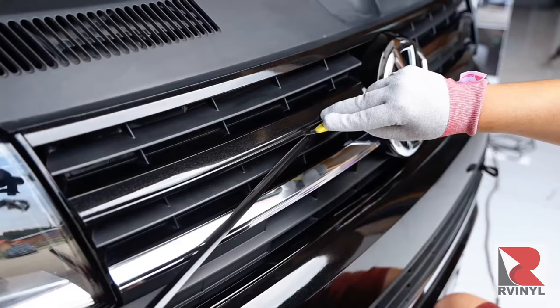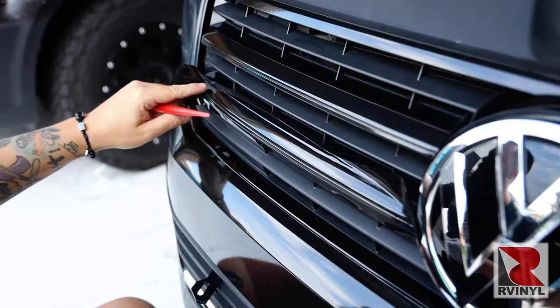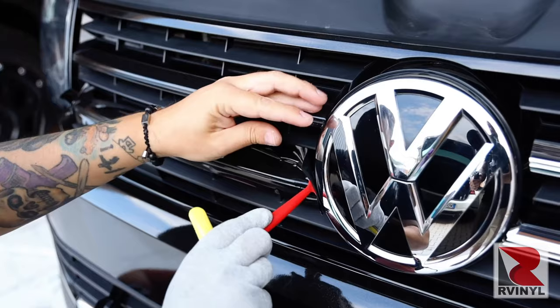Keep in mind slight modifications might have to be made to the workflow. Here the material is being formed to the main surface, but the vertical pillars are keeping the material from touching the main surface, so relief cuts are being made. This relaxes the film safely so the material can now be taken all the way to the edge without tension. This is very important to do as opposed to picking the material, adding heat, and then jamming it to the surface.